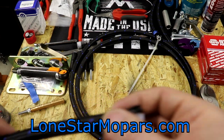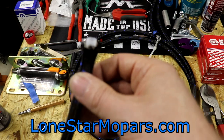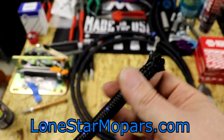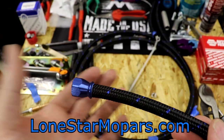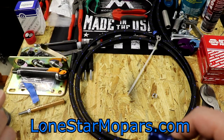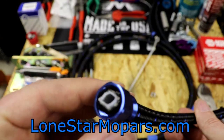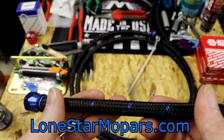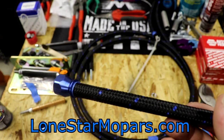This is actually very functional and practical — probably an upgrade over the expensive $50 pieces of junk they sell you that do the same thing. Even though it's a German-made drift punch, you can get it for probably five bucks. For Dash 6 and Dash 8, it's ideal — you might have to scale up for larger sizes. The fail here is this: the issue is just getting the nut onto the nylon braid with the stainless there. It's super tight. In a perfect world, the plan would have been to continue pulling that up at the vice, then pull the masking tape, slide this back down, get it into our fitting, and go to town. It's the nylon braid coupled with the stainless that's giving us tons of stupid little issues.